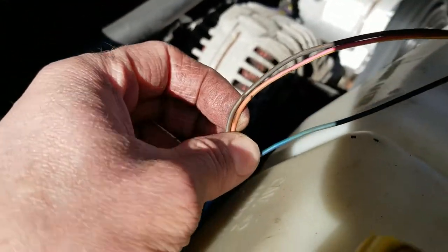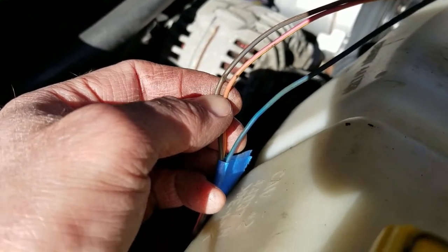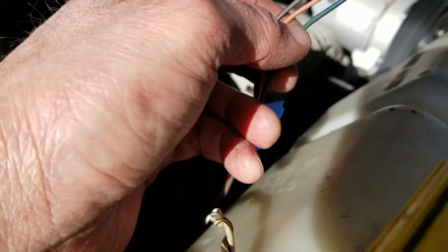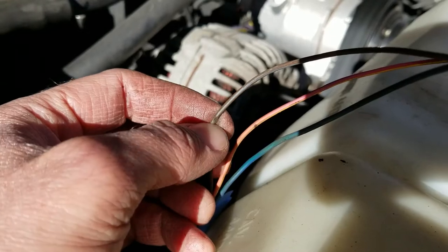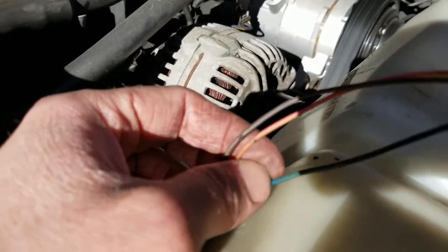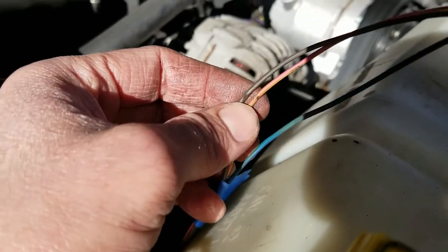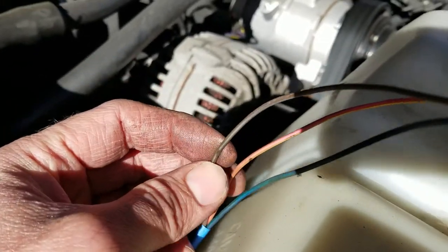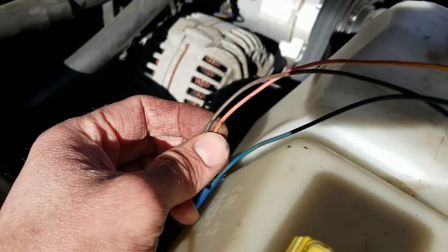So I'm going to start there — that's the low-hanging fruit. I'm going to clip these off and splice in a section of new wire. I might leave the third wire alone. I mean, I don't want to jinx it, but if it's this easy I'll be shocked. I'm going to start there and then fish everything back through and connect it and see if the engine runs. Let me get some wire and some connectors and we'll go ahead and make this repair.